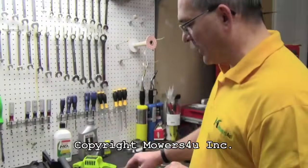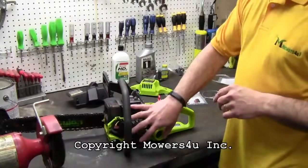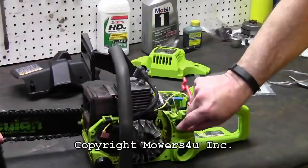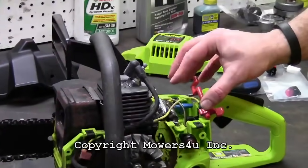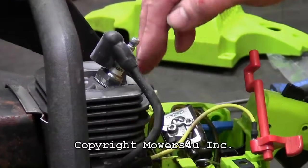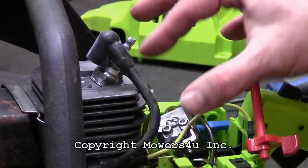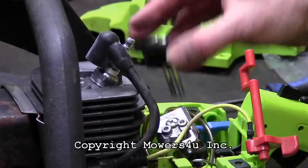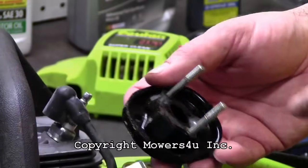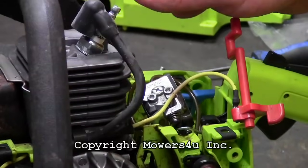So let's take a look at the saw. We took the top cover off, disconnected the spark plug for safety, and removed the starter housing. The primer bulb is held in with two Phillips screws — we have those out. I've removed the air filter housing and the intake manifold. Taking out the intake manifold, which is held by just two T32 hex head screws, makes it a lot easier to get to the return line and install the supply line. If you're careful, you won't damage the gasket.